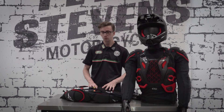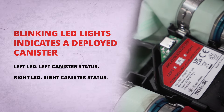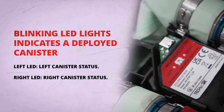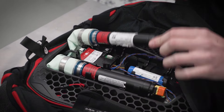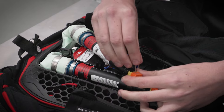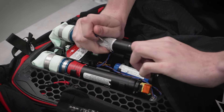Now that we have the screwdriver out, we need to find out which canister has been deployed. We can do this by looking at the LEDs on the top of the ECU — one or both will be flashing in the case of two deployments. Once identified, use the screwdriver to lever off the locking connector by inserting it in the indicated slot and levering off the orange half of the connector.